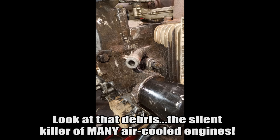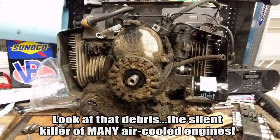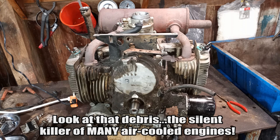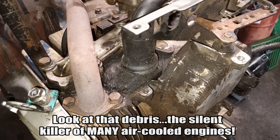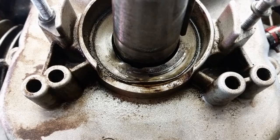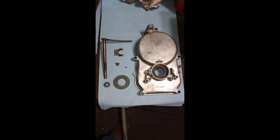I've pulled the flywheel covers off of several engines and found what looks like a rat's nest inside — actually the result of oil and sludge buildup collecting a lot of grass and dust. That will cause the engine to overheat in a heartbeat. If you're going to go to the trouble to pull your engine out, take the flywheel housing off and make sure that it is clean. The front main seal is inside the timing cover behind the flywheel and must be changed when you take the timing cover off — for a fly ball spacer job, for instance.